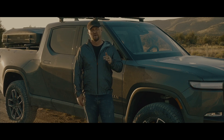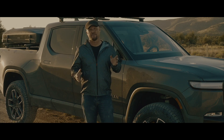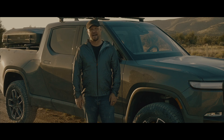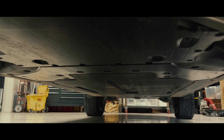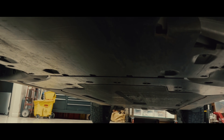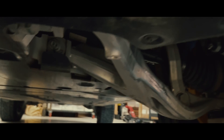It has four-corner airbags and you can get up to 15 inches of ground clearance — we needed all of that today on the rocks outside of Sedona. The underside of the vehicle, because it's an EV, is completely smooth, which means it's just a heavy-duty skid plate to protect those batteries, with really nothing hanging down other than a couple of the lower control arms.